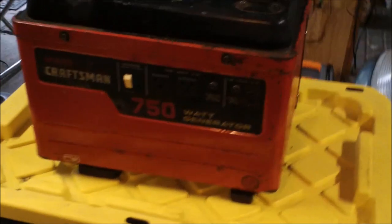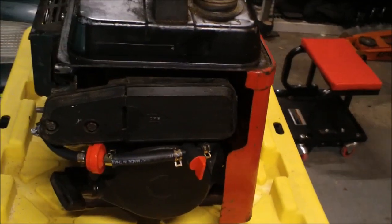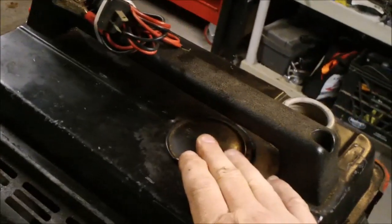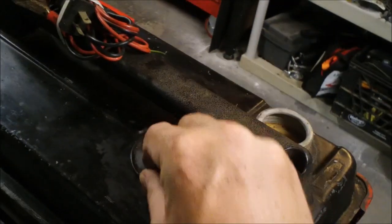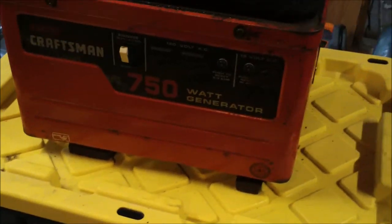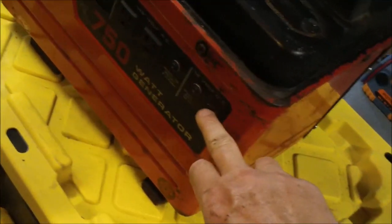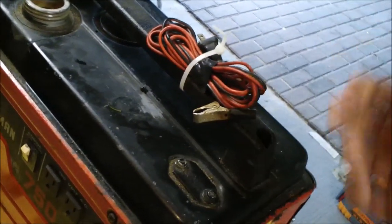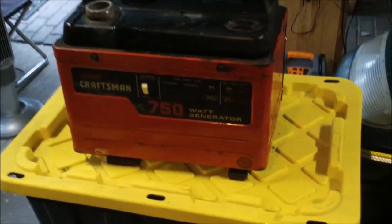Okay, that's it for this video — a real quick polishing of this turd. When my friend gets it he'll have the fuel shutoff and a filter, won't have to worry about that, it'll be filled with ethanol-free fuel upon arrival. The spark plug has been looked over — it wasn't oily and dirty and it didn't look like it was burning too lean, so it's been sanded a little bit to assure the spark will be strong. The oil change is done. The cool thing about this is it came with a DC adapter or plug which allows you to charge car batteries, so should you have a battery issue for whatever reason, you can use that as your charger. Thanks for watching.